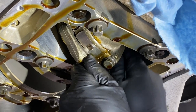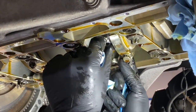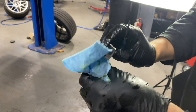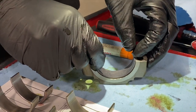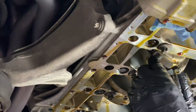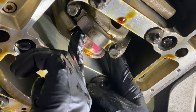I change my oil about every 5,000 miles and during every oil change I collect a sample and send it off to Blackstone Labs to see what levels of solids and metals are coming out of my engine. I've received nothing but stellar reports. As far as these rod bearings are concerned, I'm not surprised — there was no significant wear, but they certainly were on their way out. It's important to keep in mind that when these do fail, they fail rather quickly, so you might not pick up on it at a 5,000-mile interval. The difference between functioning and failure might be a lot shorter than that.